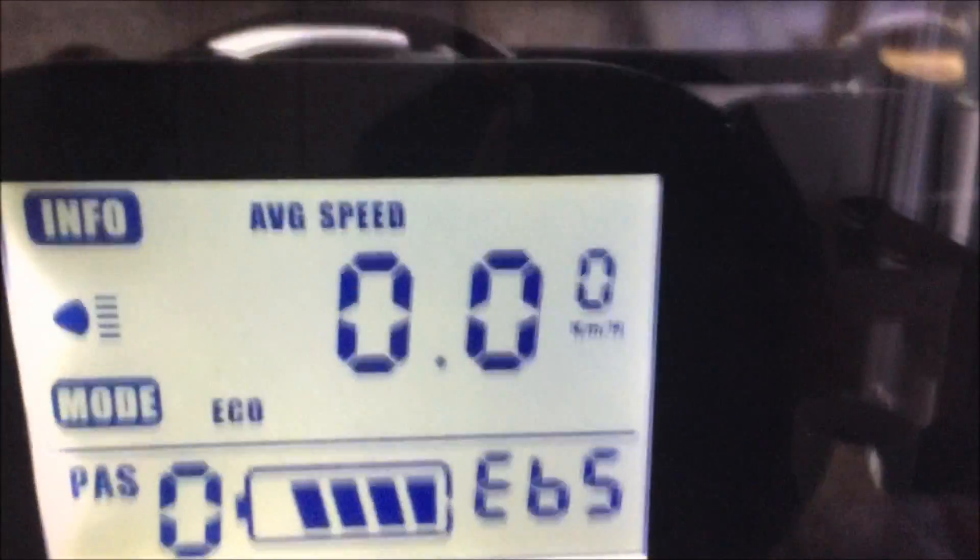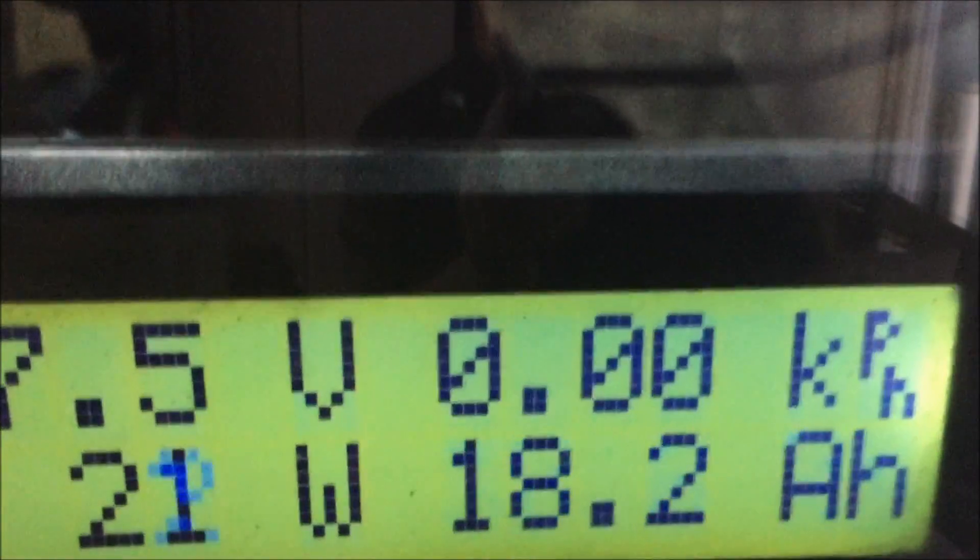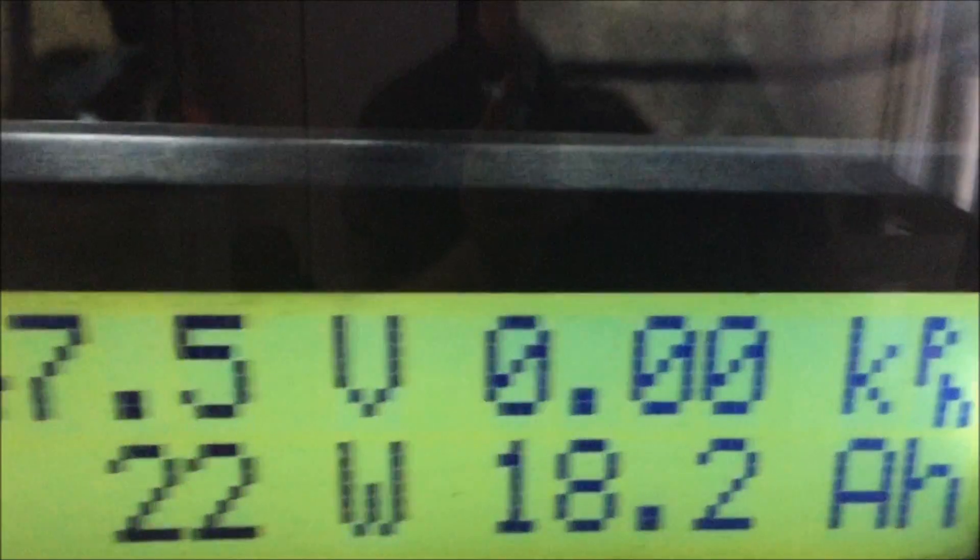You can now see one of the bars has gone off the battery. At 36.7 amp-hours total capacity, I've burned 18.2 amps before the first bar went off. Throughout the trip it did keep a pretty accurate speed. There were slight differences between the Cycle Analyst and the Smart Display, but I think I just have to tweak the settings to get them the same.